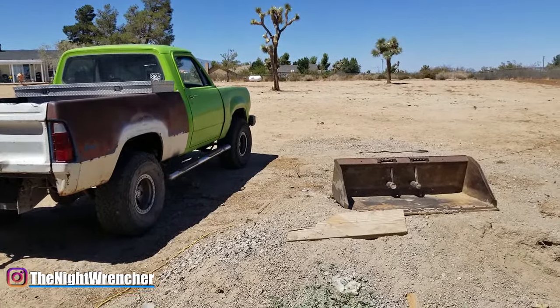If your engine starts stumbling, you know you went too far lean. But in a rich condition, you can go pretty far and the engine will still run pretty good because you won't notice that you just lost 20, 30 horsepower. I've got plenty of other carb tuning videos — you guys just got to open up the playlist and watch them one by one to get an overall picture of what you should be doing when you're tuning. So that's about it. I'll see you guys all in the next one. Nightwrencher out.